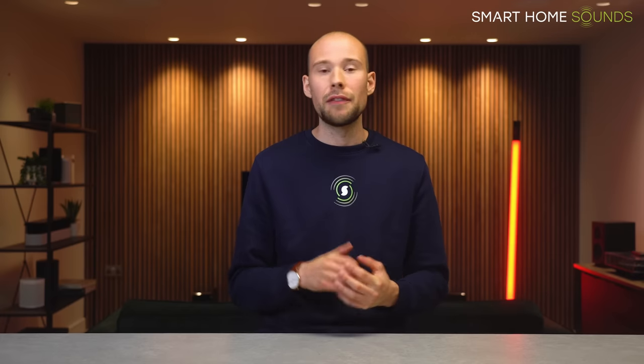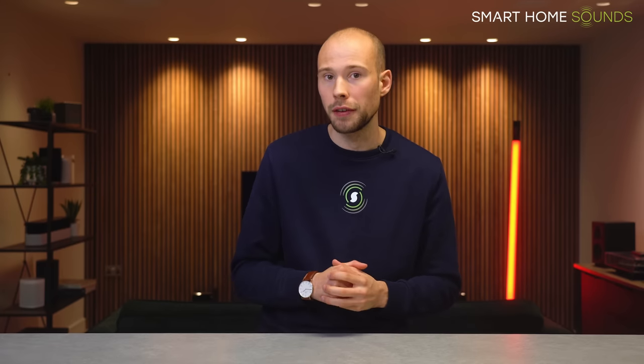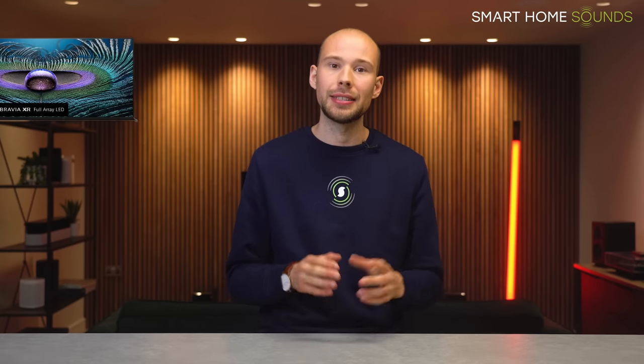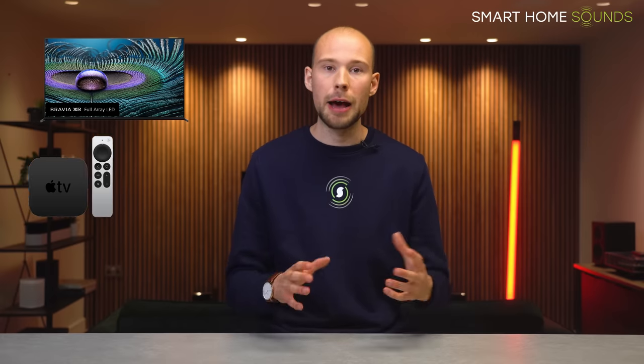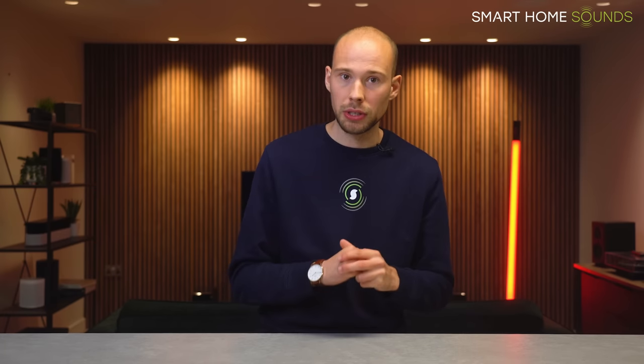In a nutshell, if you're looking to get uncompressed Dolby Atmos sound from your Sonos Beam Gen 2 using Apple Music's new spatial audio feature, you'll need a TV that has an HDMI eARC port, an Apple TV 4K, and an Apple Music subscription. To get compressed Atmos, you just need an Apple Music subscription, but you may want to wait until Amazon Ultra HD gets released, which is pretty much the same idea as Dolby Atmos Music on Apple Music, as that will be supported natively on the Sonos app at 24-bit, 48 kilohertz.